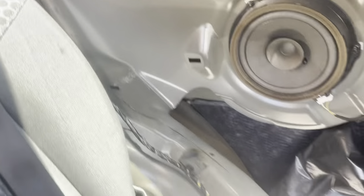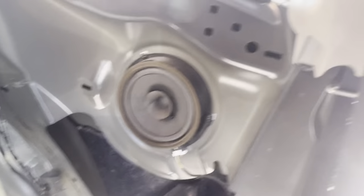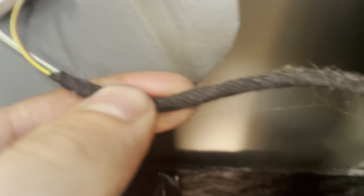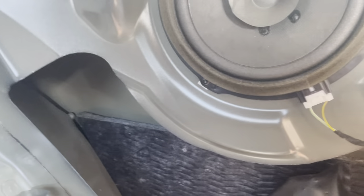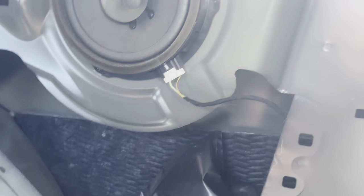Make sure you've got all the clips pulled out — they run around the outside, and there's one here. The difficult bit is actually getting the panel out: put the seat halfway down, rest it on your knee, and rotate the whole plastic piece out. We need to do this to access the rear speaker cables, because we're going to splice into them for our RCA.